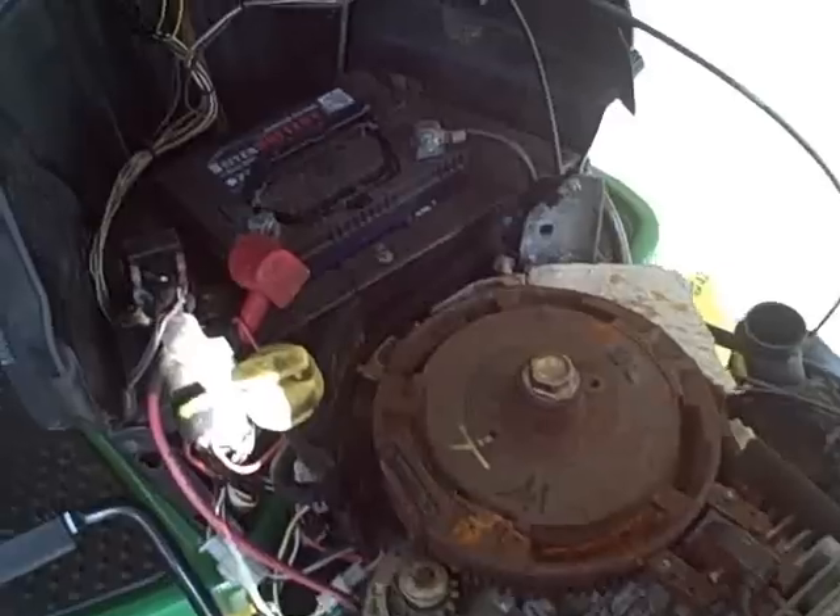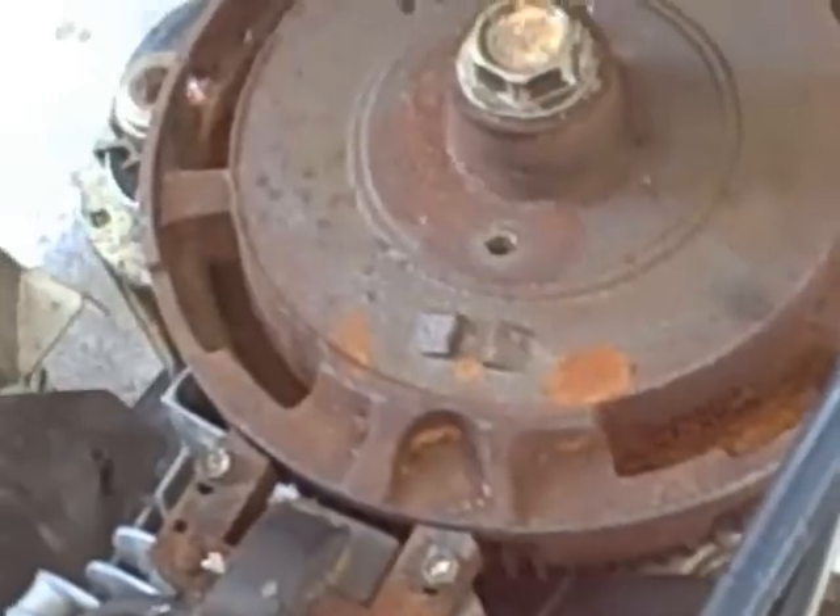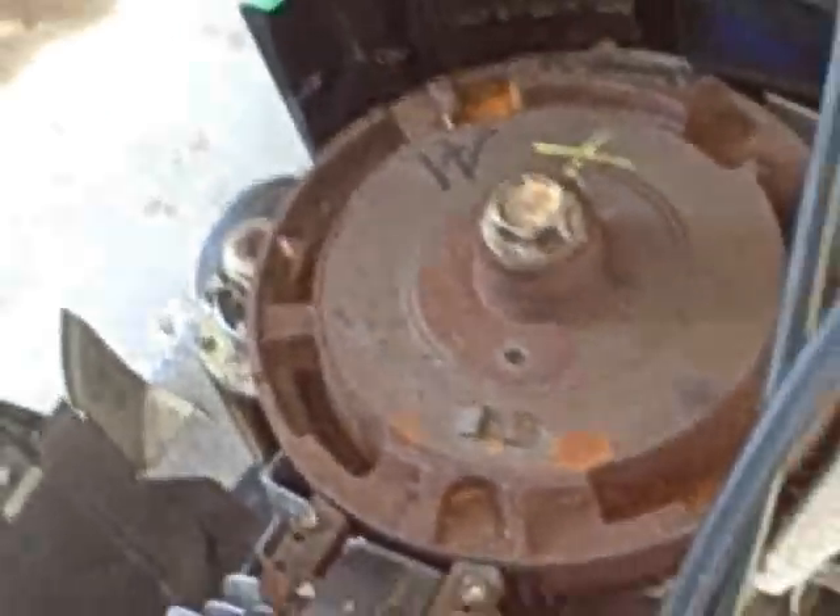In any event, we're going to go ahead and hook it up to the car and see if we can get a jump on this battery and see what's going on. And I am seeing something — we definitely have a good spark. So that rules out anything wrong with the ignition coil, which is right here, and anything going on with the flywheel. Underneath the flywheel is the alternator, so let's keep troubleshooting.